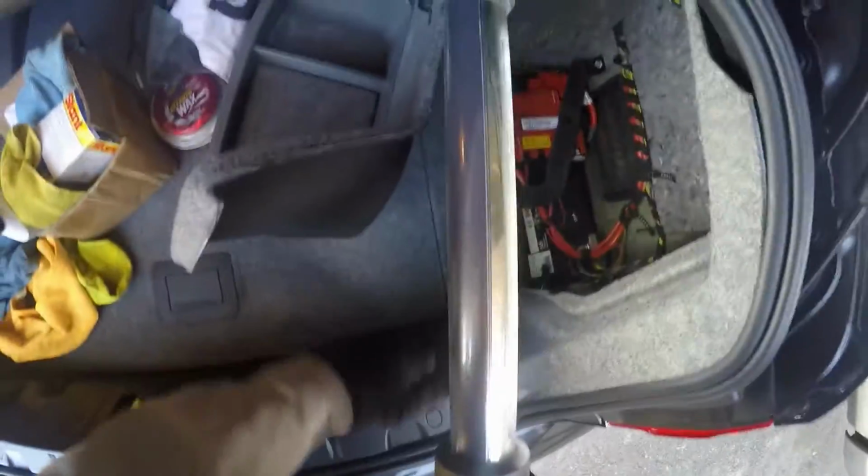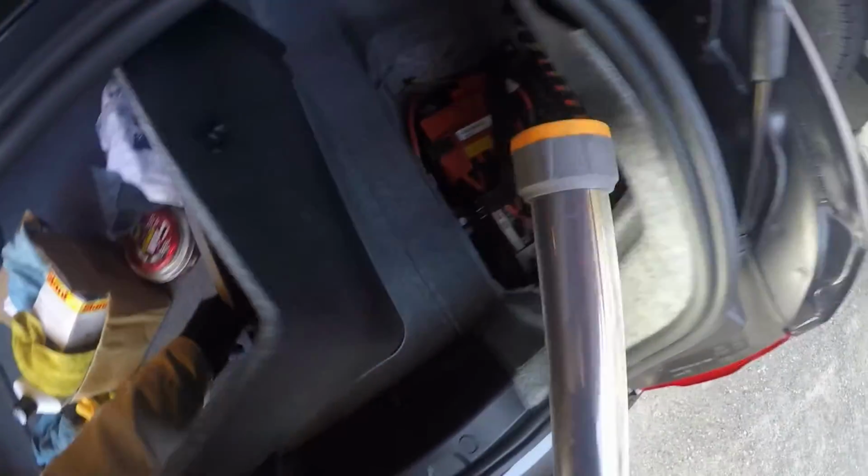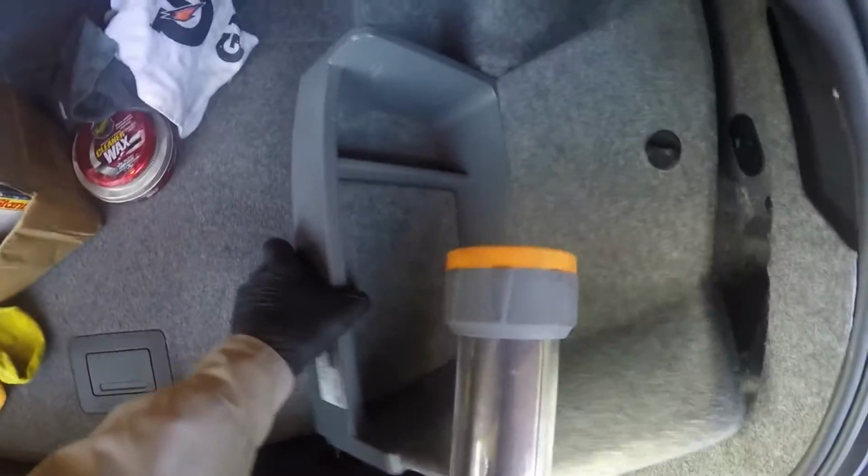So whenever you're messing with BMW batteries, don't stick your charger up to the battery side. Go into the engine compartment. You'll see a little red post for the power, and there's a little ground post right by the hinge. So don't ever make that mistake. You'll regret it. Having your car totaled because the airbags deployed is stupid.